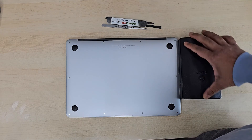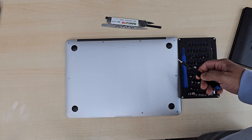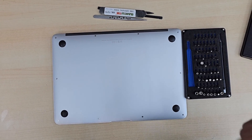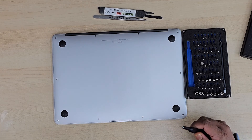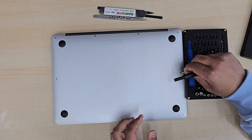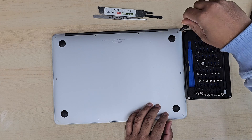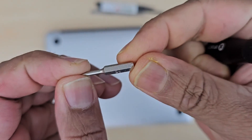As you can see, there's also a flat opening tool — both metal and plastic. I'm going to use the screwdriver to take out all the screws. Then we're going to disconnect the battery first. Once the battery is disconnected, we'll disconnect the LCD connector, the Wi-Fi antenna cable, and the camera cable — the webcam. Once we remove those, we'll be able to take out the screws from the hinges, pull the screen off, and repeat what we've done.